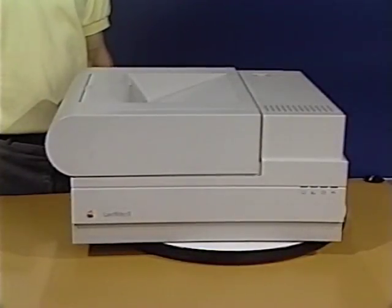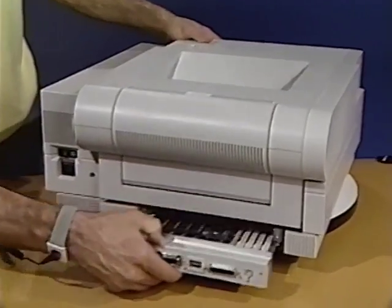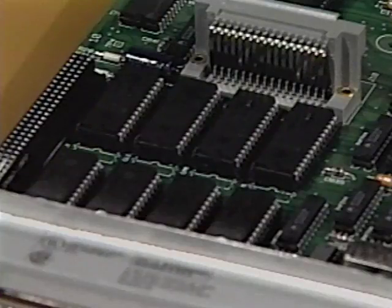Next, we'll locate the control system and its five major parts. The IOPCA is located at the bottom of the printer. It controls communications between the printer and external computers and generates the user test print.